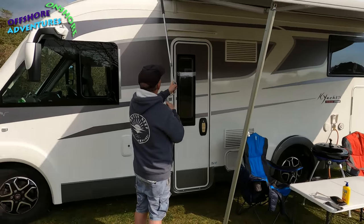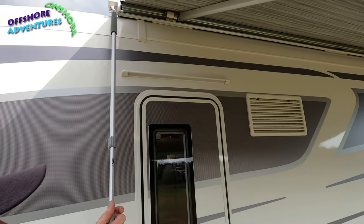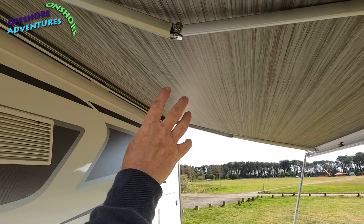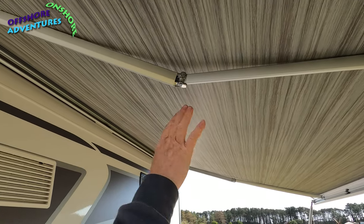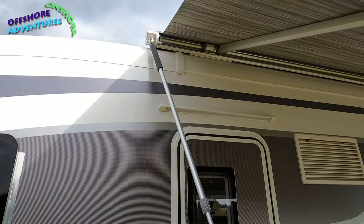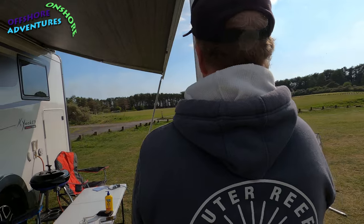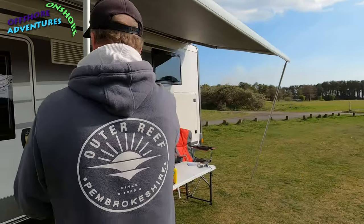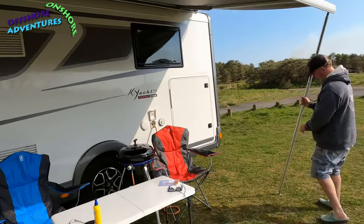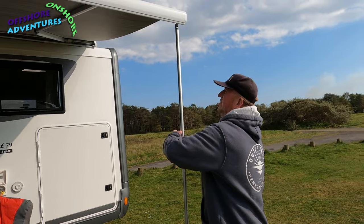You can just see up on the track that the awning canopy cover has just come to the end there. You'll also see that these up here aren't supposed to come right the way out and lock in a straight position — they stay in this kinked position, because we've wound out the awning completely and there's no more left. So now I'll take these legs back and get them as vertically as we can, and choose the height that you want your awning at. Just make sure those are nice and tight.